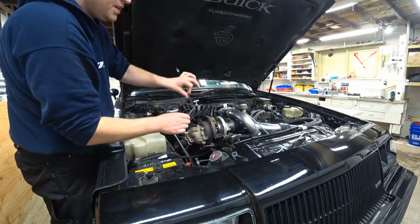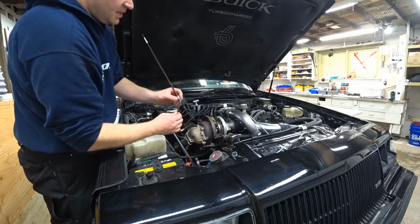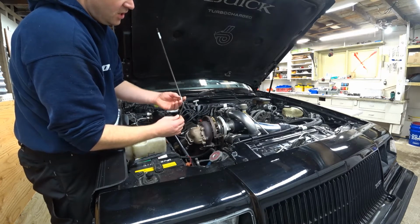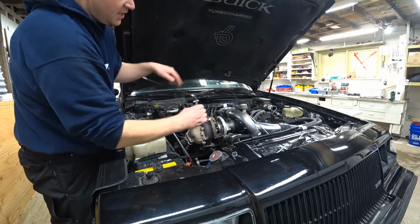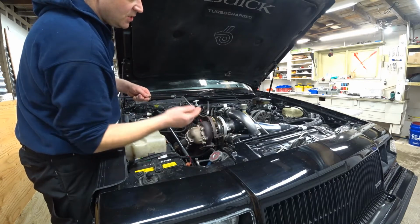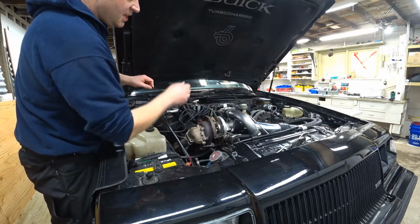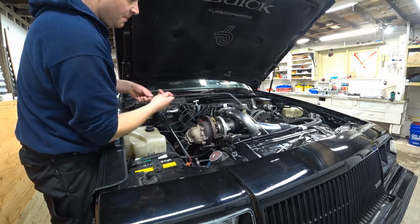Again, pay attention to where your nut is. If I went and made the next bend, not thinking about it, then this nut could get stuck because it's the tall nut, and the tall nut doesn't want to work around a corner. As you can see right now, this thing will not go around this bend. So make sure you have your nuts where you need them to be, which is way far away from the bend. Make your bends, and then your nut will be there.